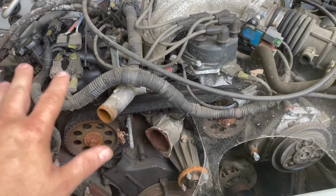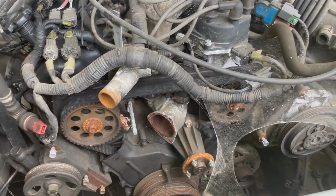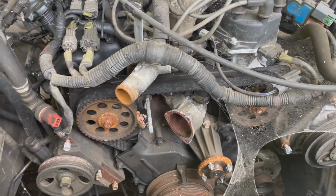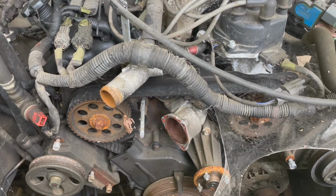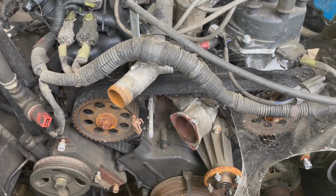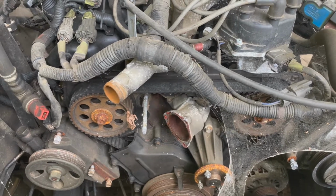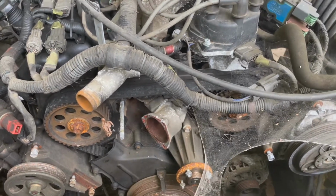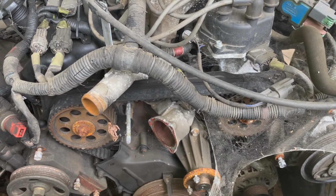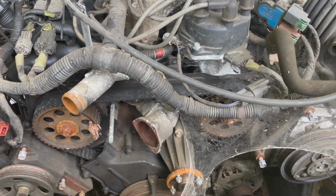We're going to tear all this down, and we're going to replace the head gaskets on it. It's got known bad head gaskets, which is very common on these Xterras, the VG33E. Really, the main problem that they have, you replace the head gasket in these things, and they're good as gold. So anyway, we're going to get started on that, and we'll go from there, checking everything out.